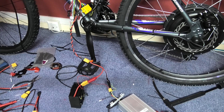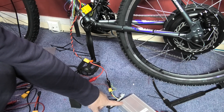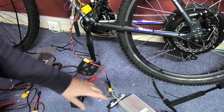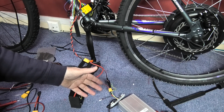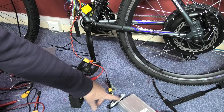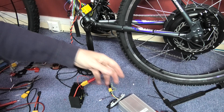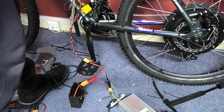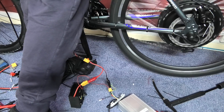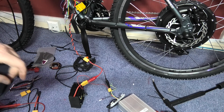Just to test this thing out and make sure everything works, I have the old battery out of my scooter which is 10s giving 42 volts, and I've got another battery which is 12 volts — a 3s — giving me 13s total. These aren't fully charged; total output is 52 volts. I tried the 10s fully charged at 42 volts and it won't fire — the low voltage cutout is a bit high. After adding the extra pack I've now got 52 volts and it works.